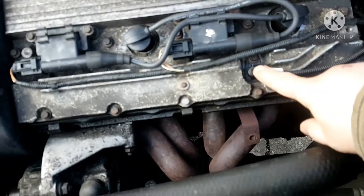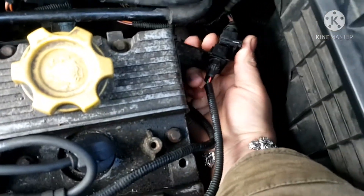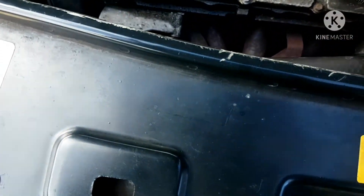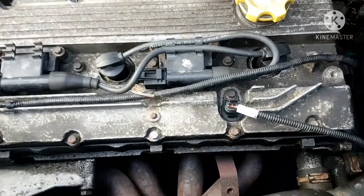There's a cam sensor here — I'm going to do one sensor on this. We'll just take it off. There's a plug right there, this guy here pops up like so, and there's just an 8mm right there, so we'll grab an 8mm.